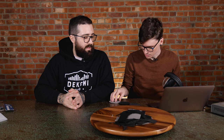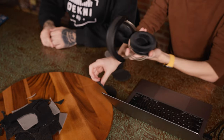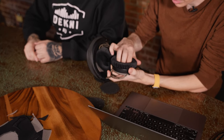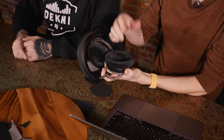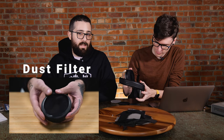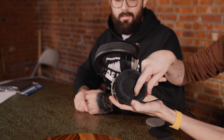It's kind of hard to differentiate them on camera, but this one would be the specular foam. Luckily I don't even have to take the pads off — I can just kind of take it, put it in here, and tuck it under the edge. Beyerdynamic stock pads don't actually have a dust filter, so if they did you'd probably want to pull the whole pad off and put it on. With the Dekoni pads we do offer a dust filter and that also offers a little bit of attenuation. Here's the regular cup, and here's the cup with the foam — I just tucked it under this lip all the way around, nice and easy. I'm going to do the other side and then we'll listen.